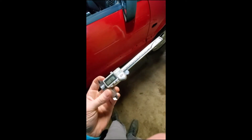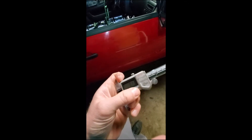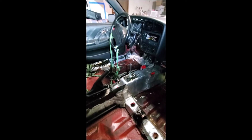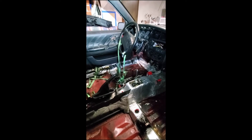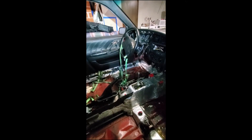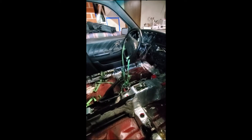Let's do the prerequisites first. You need a good tool to do your measurements — not Harbor Freight. You need something good like a Mitutoyo, Brown and Sharp, anything with a name brand that's going to be accurate, because you want accurate. And you also have to be able to zero it, which pretty much all digital calipers can do. Also, take some ratchet straps and lock the steering wheel down. You cannot rely on the column lock to hold that wheel — it will move as you're adjusting tie rods. So ratchet straps for the win.